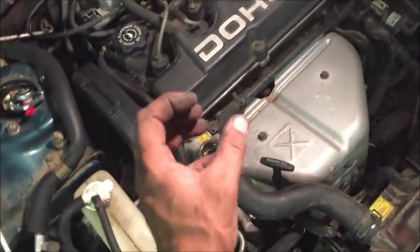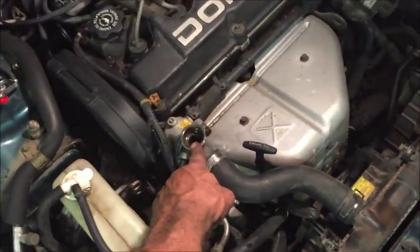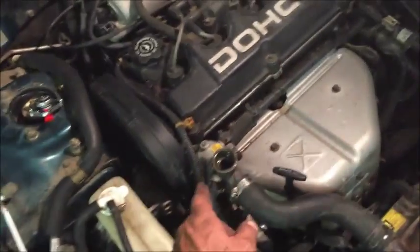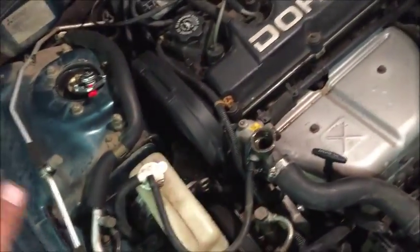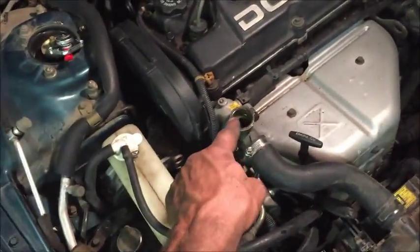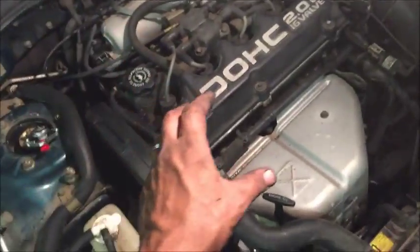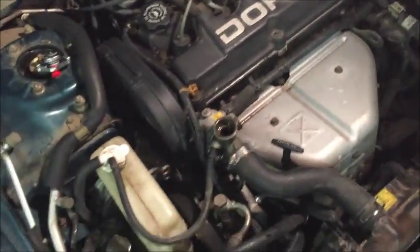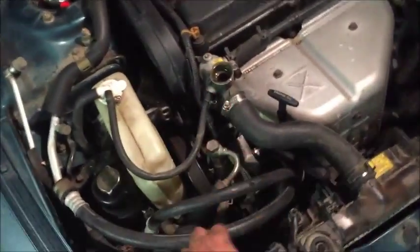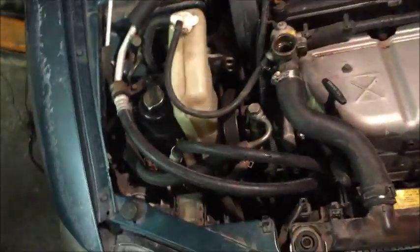What I'm doing right now is burping the system, because we had the water pump off and so we got air in the line. Make absolutely sure that you burp this system because it will overheat on you if you don't. The way you burp it is just keep topping up with water and letting air come out for a minimum of 20 minutes. Let it idle — don't go driving around. Burp that system first or you're going to have overheating problems. Air gets trapped inside that engine and it won't come out — it just sits there and causes overheating. Keep flushing water until it's full and check the level on your overflow; keep it at the full mark.